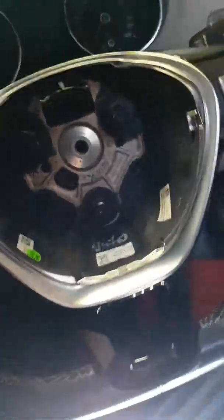Once you get there, just pop this white clip up with your finger and then squeeze it in to release it. Then you've got your black connector at the top — there's a little tongue that you have to push in to release. Push that in and pull it at the same time, and there's your airbag off.